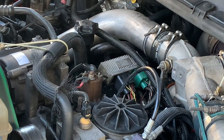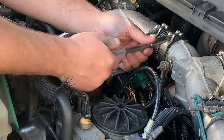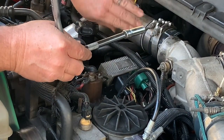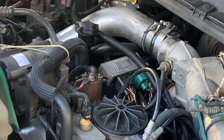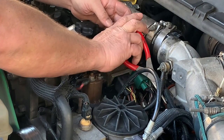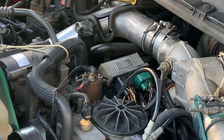That gives me a pretty clear view to the bolt head. Next I'll go ahead and take off the CAC tube because that'll give us access to the bolt on the back side. Also there's a little hose that goes from the MAP sensor to the intake manifold — I'm going to take that off. It's just got a spring clamp that holds it on. We can tuck this out of the way a little bit, and now we should be pretty clear to get to what we need.